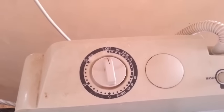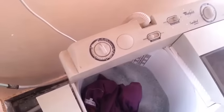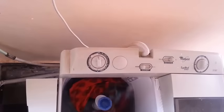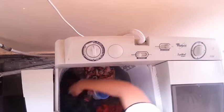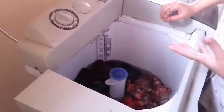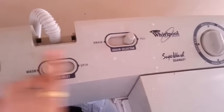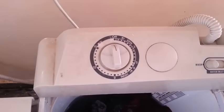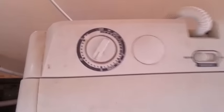I am going to put 5-6 kurtas to wash on normal wash for 9 minutes. Here I put them in — that's 1, 3, 5 — that will be enough for level L. Because these are very soft cotton clothes, they don't need a lot of time to soak. But if you are washing jeans or bedsheets, give them about 20 minutes to soak. The drain selector is on fill, the water inlet is on wash, and the runner is set on normal wash. Put the lid over it and turn the timer to 9 minutes. The wash has started.